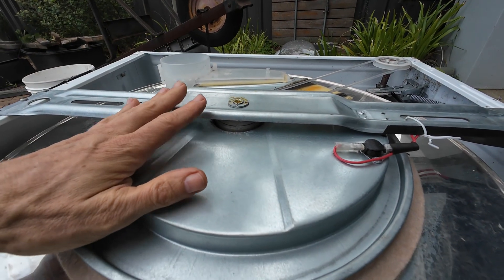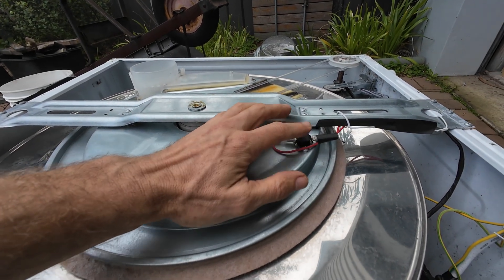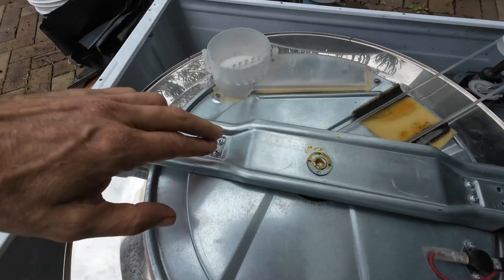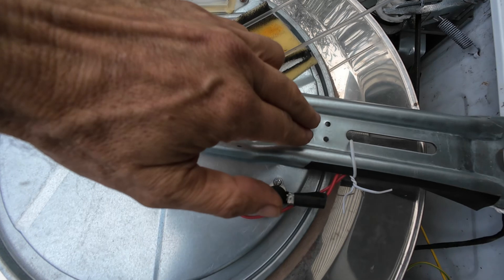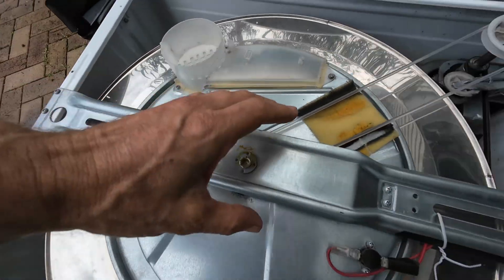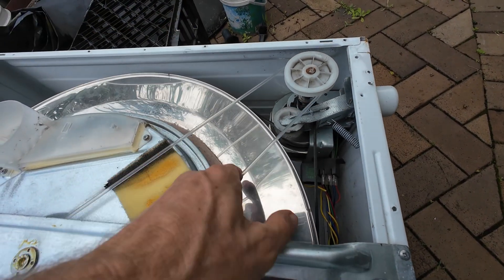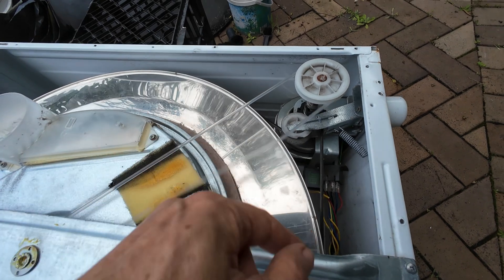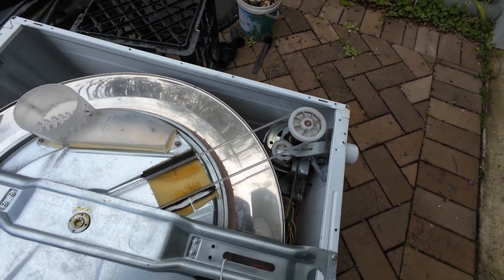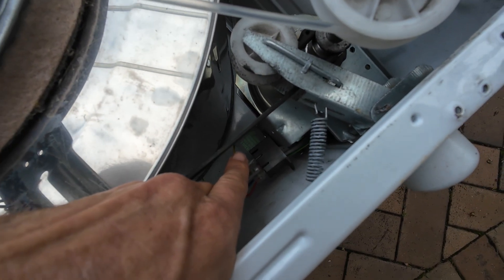You shouldn't start it without a fan belt because if the thermistors aren't working and they don't protect the start mechanism, it'll fail. To get it on, you've got to undo these screws at the top and slip the fan belt over and pop it on this pulley. It feels very tight, but once it's on you can see it's reasonably tight. Here's our start capacitor down there - we'll have a bit more of a look at that in a second.